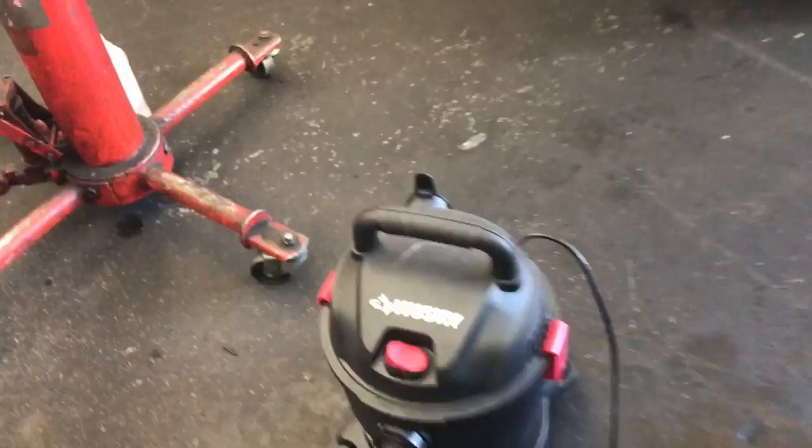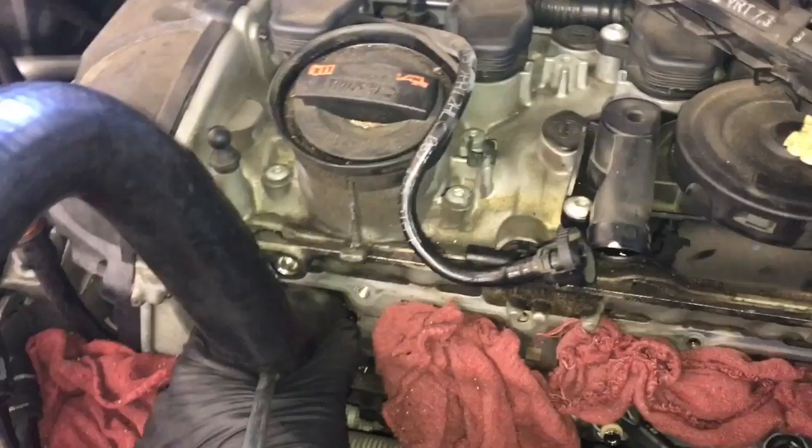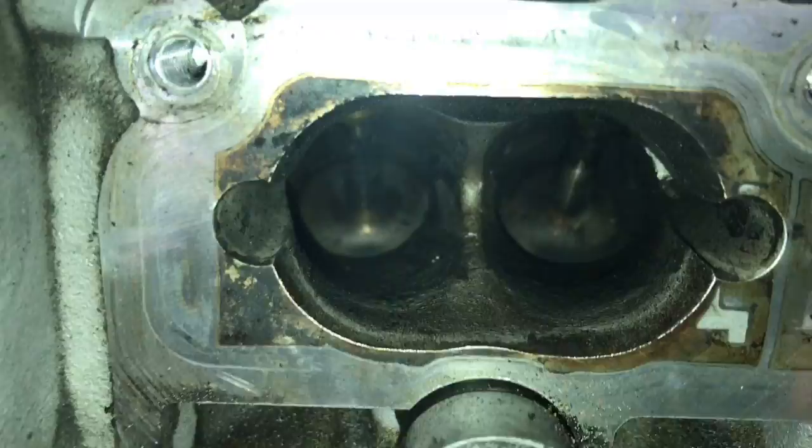Now you're going to pull the trigger on the gun and aim it at the left and right intake valves in there, and about 30-40 seconds worth of blasting between the two valves, you'll pull the gun back out. So after about 30 seconds on each, angling at each valve like that, maybe less than 30 seconds, then you can use a little shop air like this.